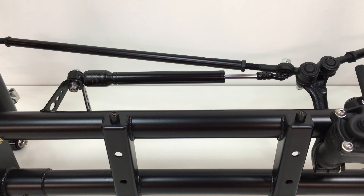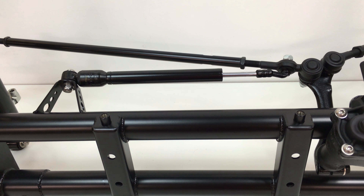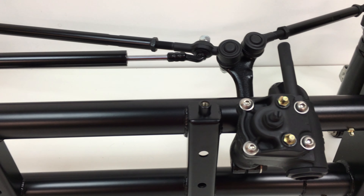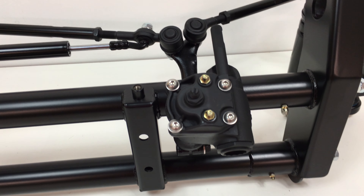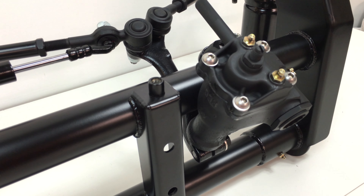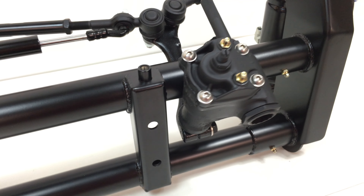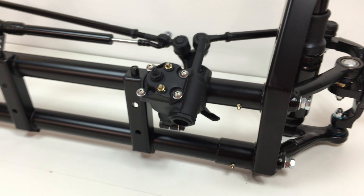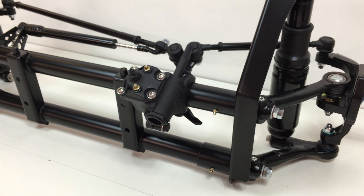The beam comes with Pro-Built arms which have German ball joints pressed in, and we break them in. Something new that we do now allows the steering to go back to zero when we do a turn. Normally we just press in the ball joints and let them break in, but we do all the break-in for you.